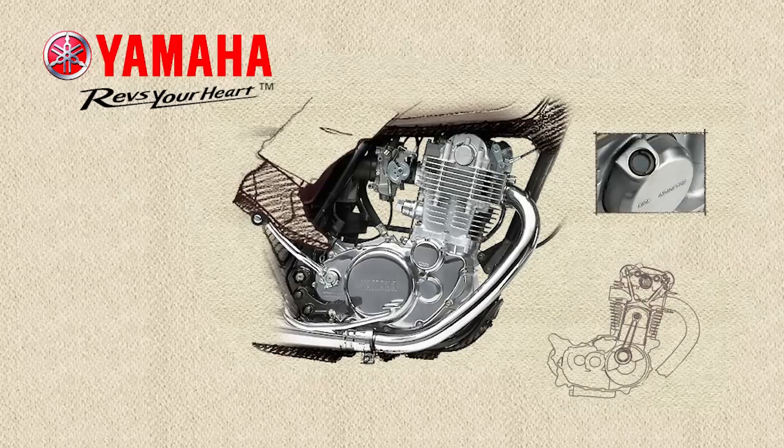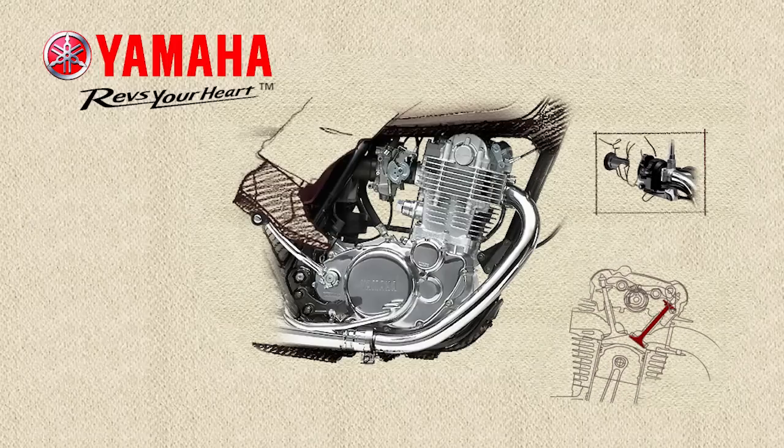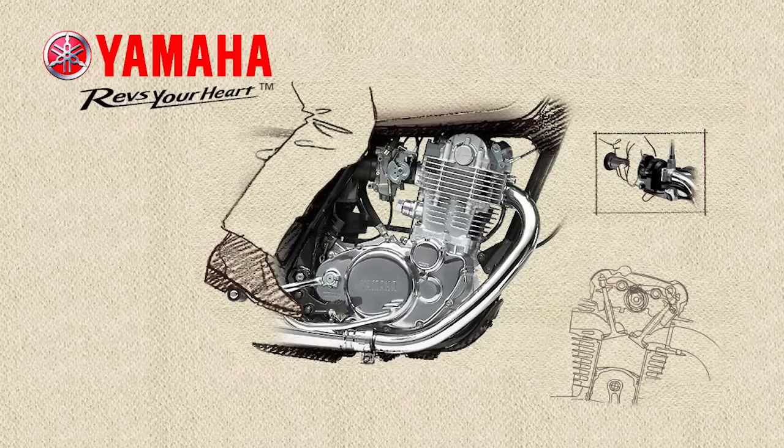Note the kick indicator window in the cylinder head is dark. Now pull the decompression lever on the left handlebar — this will slightly open the exhaust valve. Now continue to push down the kickstarter very slowly, only a couple inches further, and stop when the engine position indicator is visible in the window.